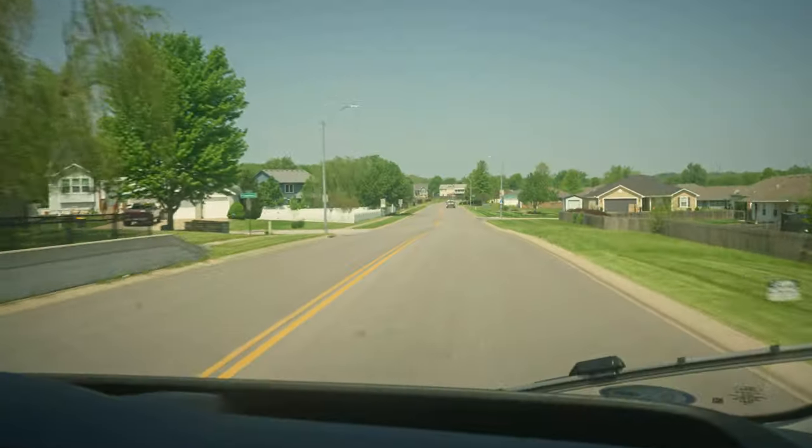That may not seem like much, but over 10 kilowatt hours of energy used, you're traveling an extra 6 miles. Over 100 kilowatt hours used, you're traveling an extra 60 miles. That's a substantial difference, and it's directly inverse of a standard gas vehicle. Gas vehicles get horrible mileage in neighborhoods, and they get better mileage on the highway. This one is actually backwards. 2.5 miles per kilowatt hour in a neighborhood, 1.9 on the highway.